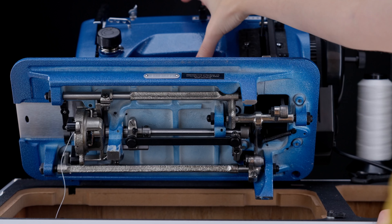If you've installed the bobbin correctly, then when you pull on the thread while looking at the case with the bobbin facing you, the bobbin should spin clockwise. To install the case back into place, pull and hold the spring-loaded lever outward to keep the bobbin from falling out, then push the case onto the axle of the gib hook. The finger of the bobbin case should fit into the retaining ring's notch. Once in place, release the lever and the bobbin will be held in place. Once the bobbin is secured, tilt the machine back into position.